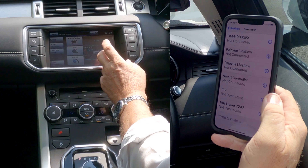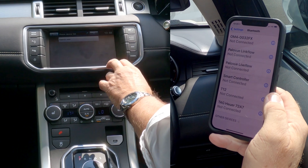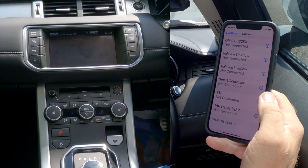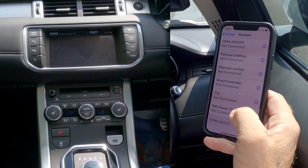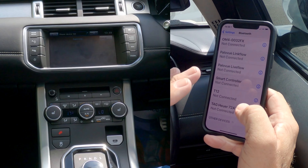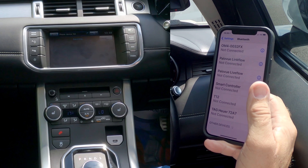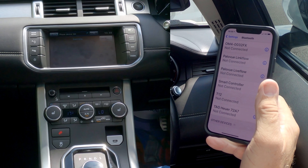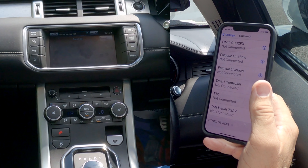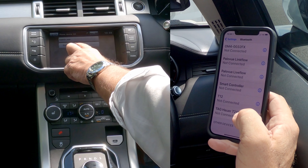Go to Phone, click Phone, then Search New. It's best to do it from vehicle to device because that should generate a random PIN number rather than you having to put one in. The audio system's searching and my phone is searching — I've only just deleted the two pairings, so sometimes it confuses it and takes a while, but we'll just give it a minute.